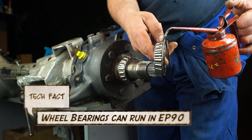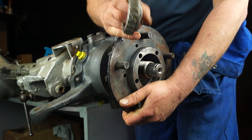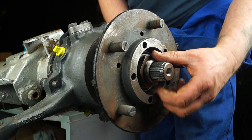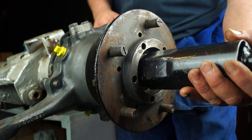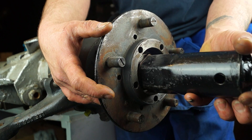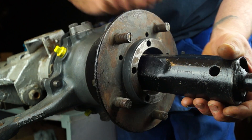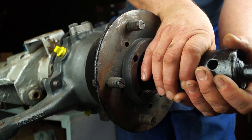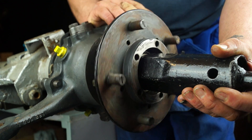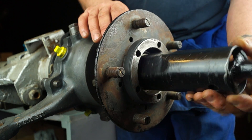What I am going to do is drop a bit of Hypo Oil onto the bearings so that we don't have a problem with them. I am not going to run this — this is only a demonstration, there is no seal in here. But what I would like to show you is an idea about what the end float is all about. The first nut is on and this is the adjustment nut. I will just quickly grab a tool and show you that this now is excessive end float — there is too much movement and too much gap between the bearings and the race. If you tighten it up, I will just nip it a bit too hard and the bearing becomes stiffer to turn because it is too tight. Loosen it off just slightly and it becomes easier. If you were a professional you would actually be able to feel this and you will know that there won't be any movement or any play, so the bearing will run smoothly.